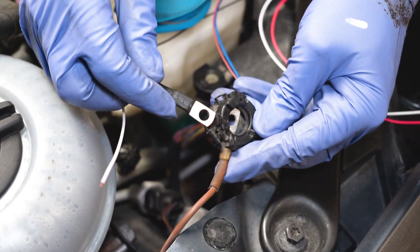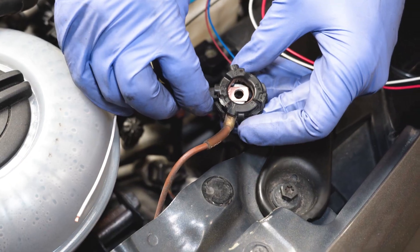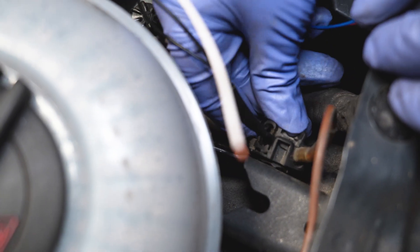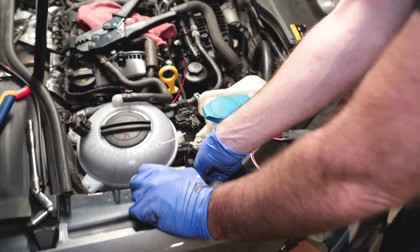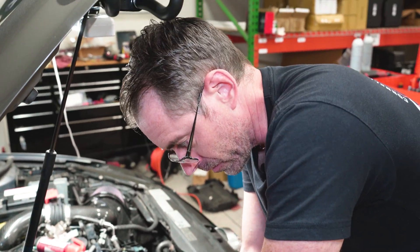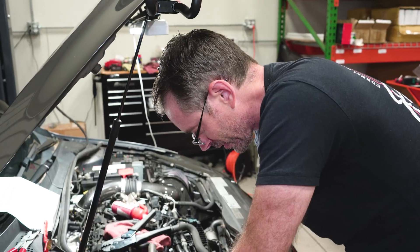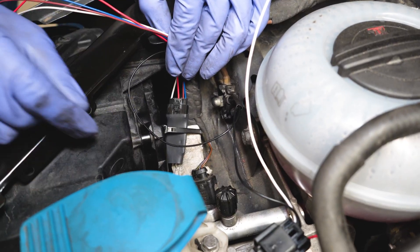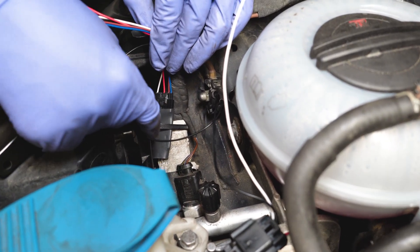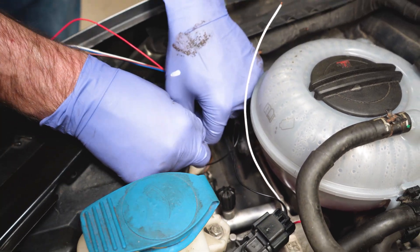That's going to go inside this housing right here — you can see crisscross over the hole. Slide her in place, just like that. I probably should have unplugged the battery when I was doing this because I just heard something turn on when I reconnected the ground. I definitely have fault codes of some kind. Right here is the little module and we're just going to zip tie it right to the harness so it will stay and live right here.